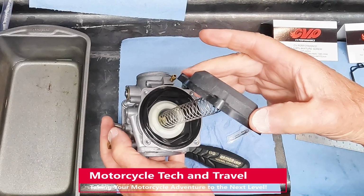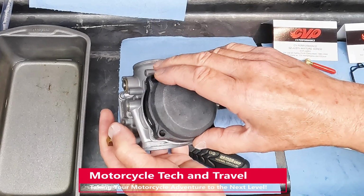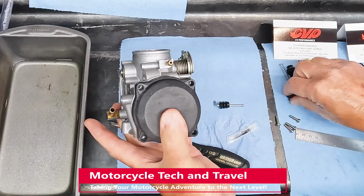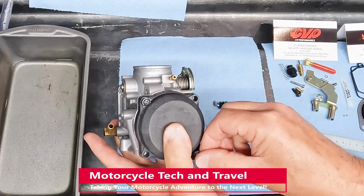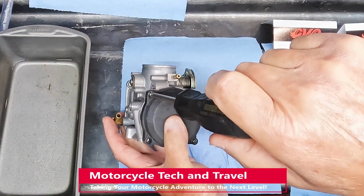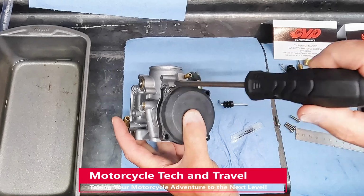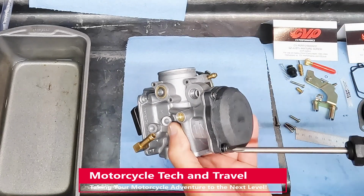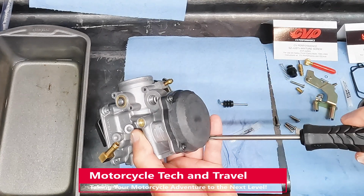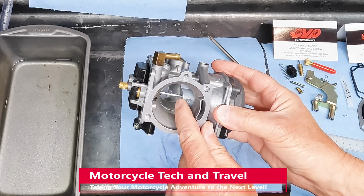Make certain that the spring is centered on the needle spring seat and also in the center of the cap. Seat the cap squarely and centered. There should be no resistance, and look for pinching. Preserving the diaphragm is the main goal here. No pinches, no folds. The diaphragm has to be sealed securely. 3 screws are installed now. The 4th screw is put in place with the cable stop bracket. Make certain the slide and needle move freely.